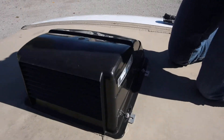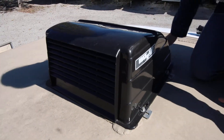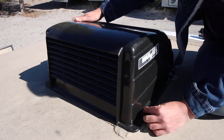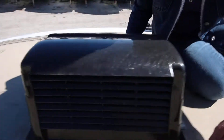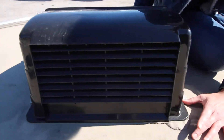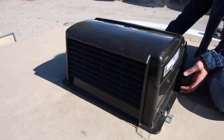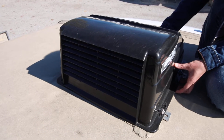While you're checking all your attachments, if you have a Max Air, you're going to want to take these four bolts out right here and make sure you check the sealant around your vent. It's very easy and it's going to save you a lot of headache if you have any leaks going down into your vent.